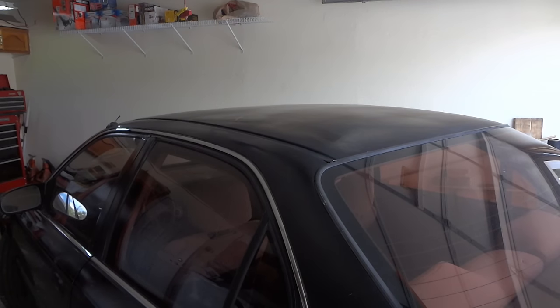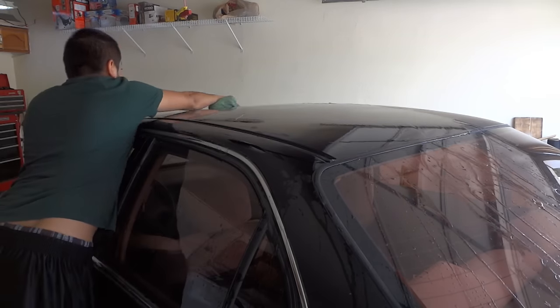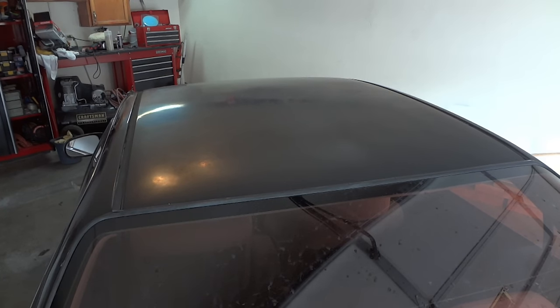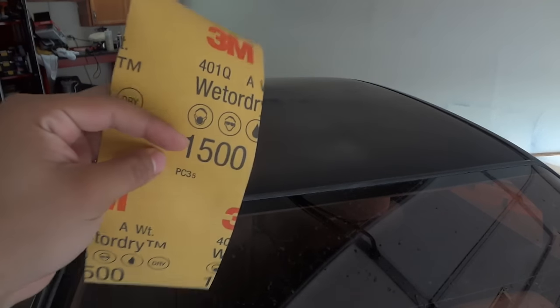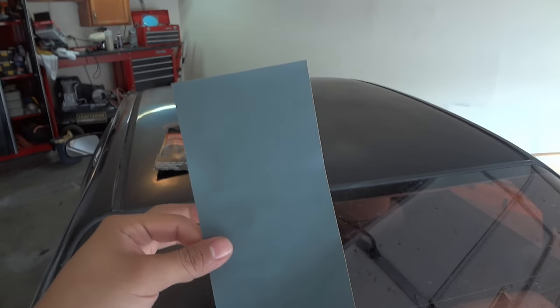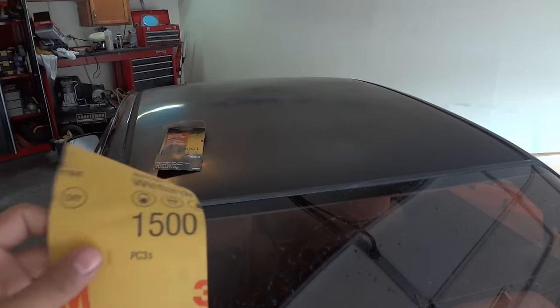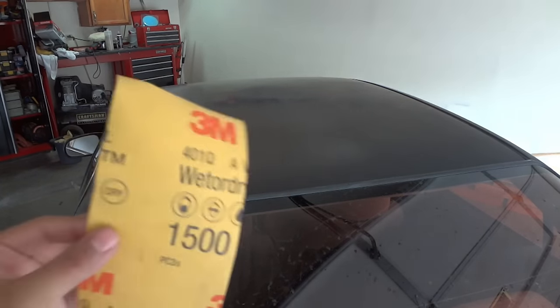To begin, let's clean the surface we're going to be working on. Now that the roof is clean we can get started with the sanding. I've gone ahead and bought 1500 sandpaper — this sandpaper is wet or dry and we're going to be using it wet. We're probably only going to use this one sheet; we don't need that much. It's just to remove the heavy oxidation that the machine is going to have trouble with. We're going to be sanding in a straight line motion, back and forth, in little areas at a time to make sure we get everything evenly.